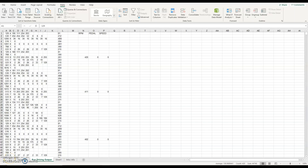I've got my data here in Excel. Just reviewed the video I took a minute ago and want to clarify a couple of things. I said the header ID sent out on the CAN bus is an indicator of what sent it - it's not. The header actually tells you what that packet of information is. Take 1201 here - I know from experience with the car that that is actually the wheel speed of the four wheels. It's not the device that sent it out, it's telling you what the information contained within it is.